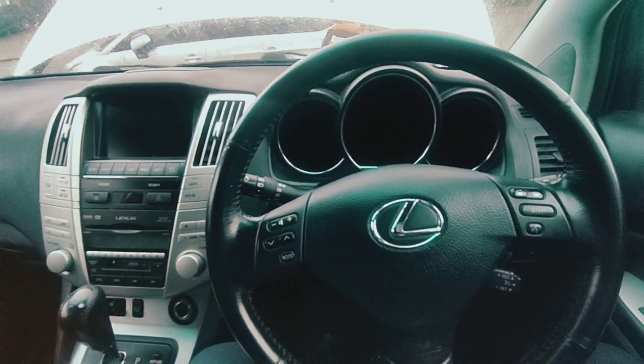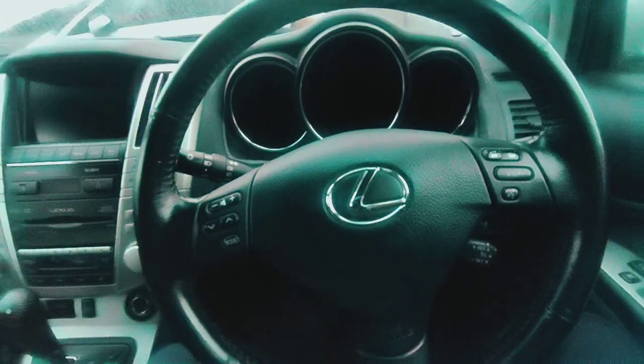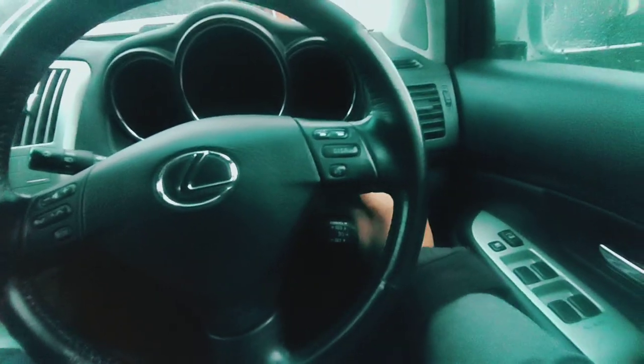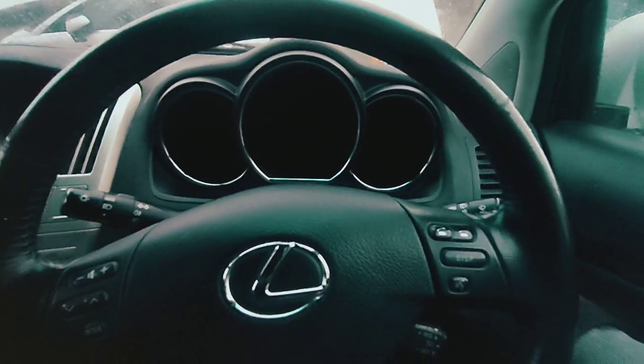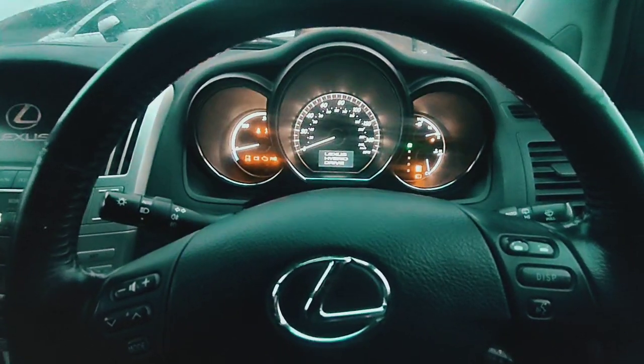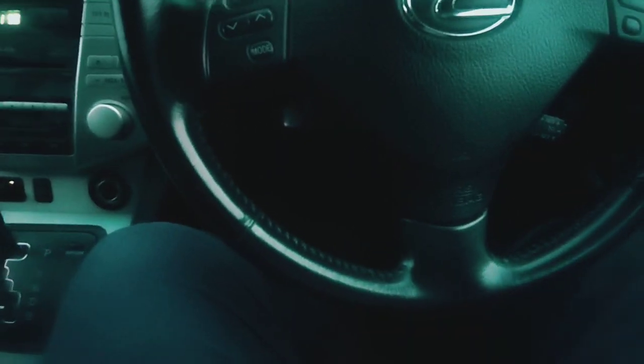My jump pack over there should give you an idea. Anyway, what you need to do — this is a foot-operated handbrake — make sure the handbrake is fully on. Put the key into the ignition but do not start the car; just put it into the first ignition position so the lights come on.